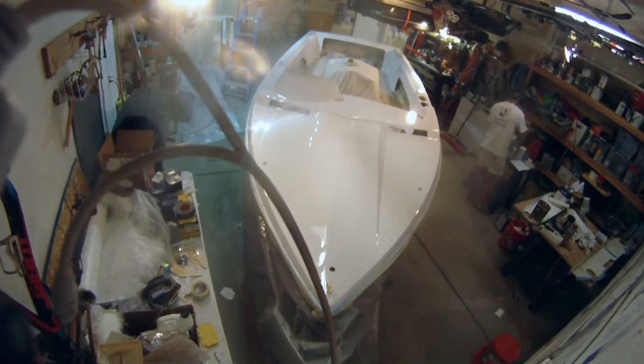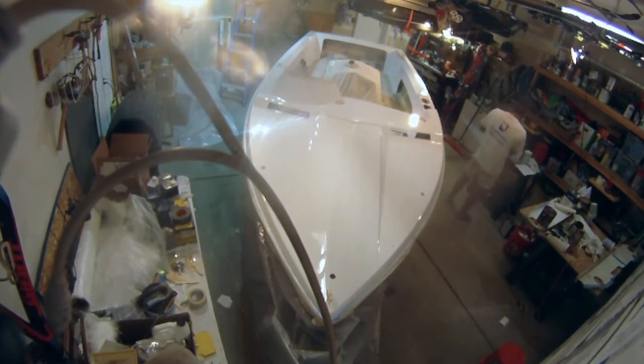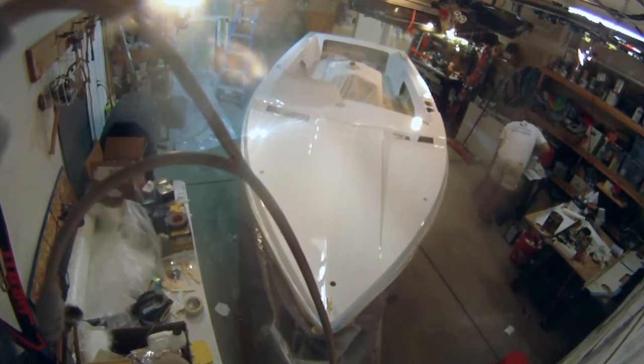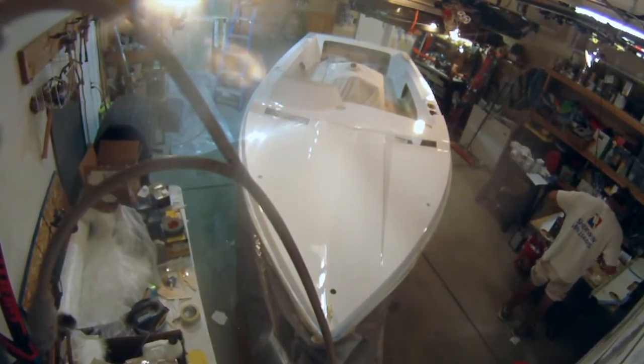I had quite a bit of paint left over after the first coat. So for this coat, I did 5 ounces of 501 top coat, 5 ounces of the converter, and 1.8 milliliters of the rolling additive. I stirred it well, then let it sit with a paper towel and box of gloves covering it.